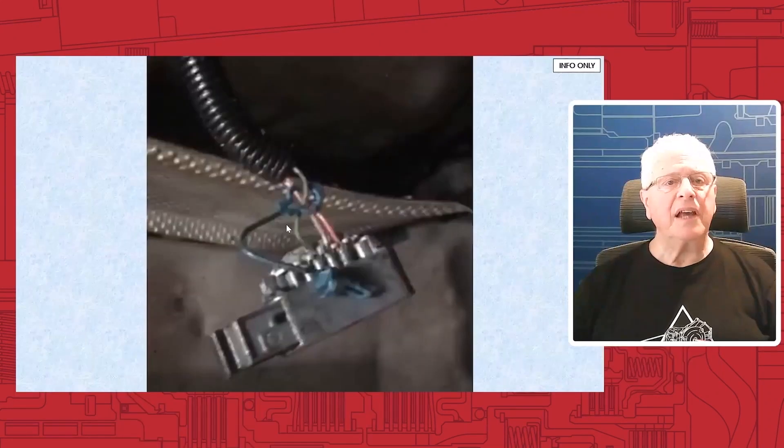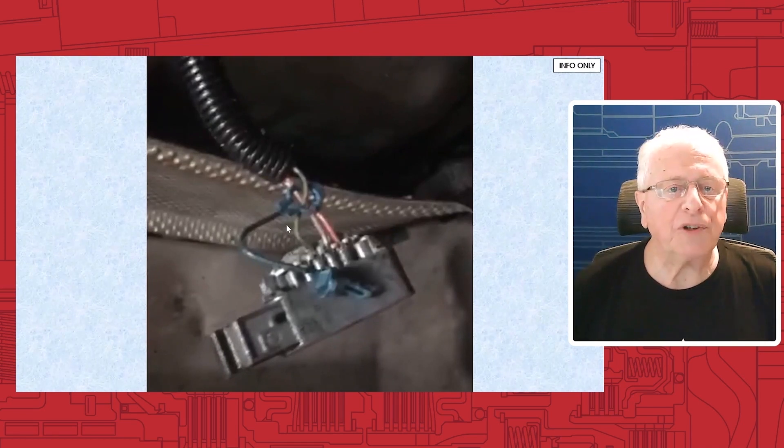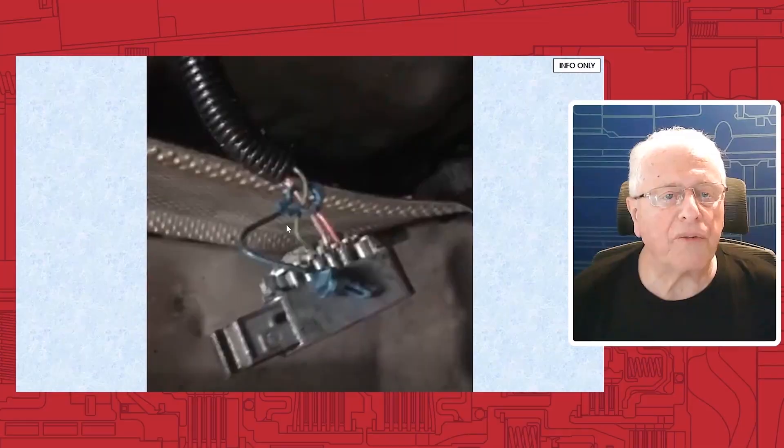It's going to be a little noisy because of the air compressor, but you're going to get a good look at that IMS sitting there. There's the park neutral switch we've been used to seeing for so many years, and it does have an IMS. Now, going under the truck, we're going to look at the connector. Take a look — three wires. You see the three wires there? That's all it has, no other circuitry.